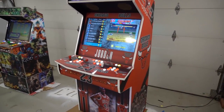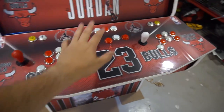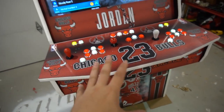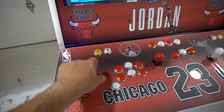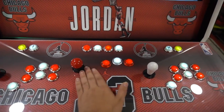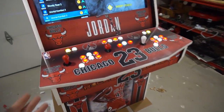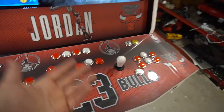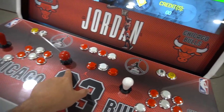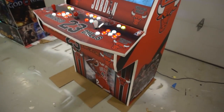We've got the 32-inch upright Pandora's Box with 4,500 games. On 32-inch control panels, I will always now and forever be putting the dedicated four-ways - that is definite. I get too many people who don't understand about eight-way joysticks. Playing Pac-Man on an eight-way joystick is brutal - you will need the dedicated four-way. So it's either going to be dedicated four-way or trackball in the middle for any future 32s. Pricing is the same whether you want two players only or the dedicated four-way. Adding a trackball will be an additional fee because the trackball costs money.